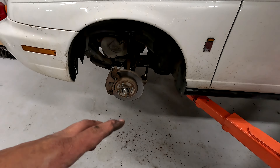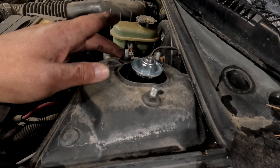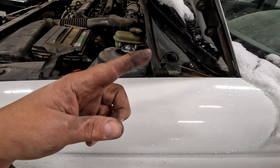Now we're ready to put the tire on — lug nuts, hubcap, the whole deal. Set it on the ground. Once you set it on the ground, go ahead and torque the top nuts to 25 foot-pounds, and then the fronts are done. Let's head to the back.